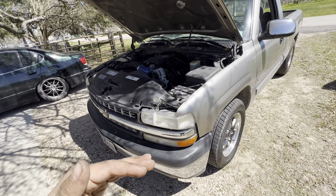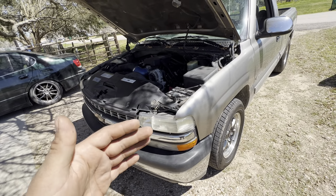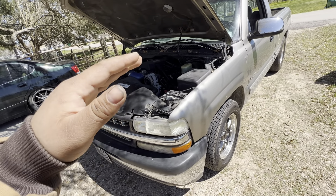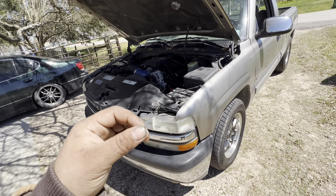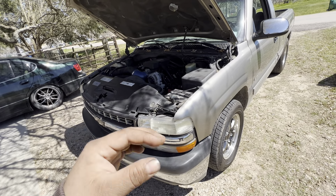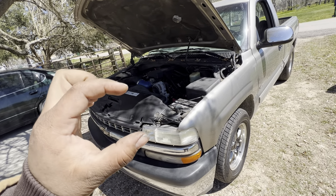That also keeps the budget down, so we're at $279 for the camshaft. The LS3 valve springs were $80 back when I cammed this truck. As a general rule of thumb, if you're using a cam mild enough to run factory LS3 valve springs, I think it's okay to use factory pushrods. But if you have a cam more aggressive than 560 lift and the duration is aggressive enough that you can't run factory-style valve springs, at that point you're going to need to upgrade to hardened pushrods — because I have seen it: a cammed LS1 with double springs bend a pushrod like it was nothing.